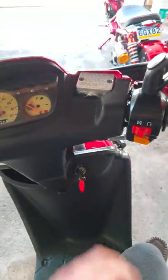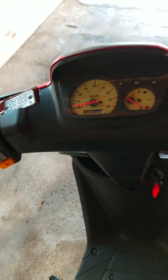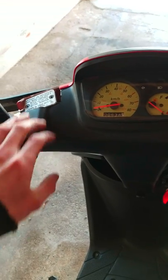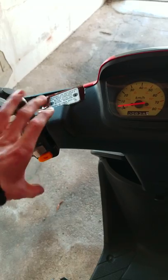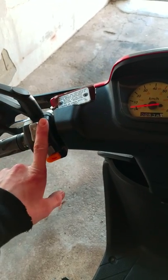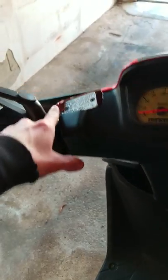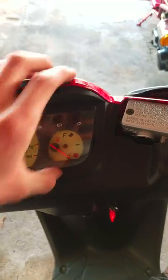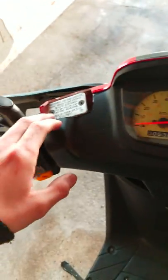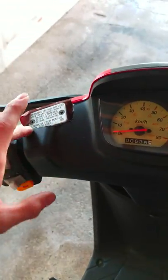Another thing was — when I had to switch over, it never originally had a disc rear brake, it was drum. The drum rear brake never had a light switch separated from it; it was all one connected piece. So I had to buy this separate switch, and I had to move back the plastic and cut it so it would actually recess in there, because once you put the two panels together it wouldn't recess — there was overhang — so I had to recess that out.